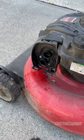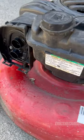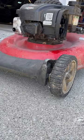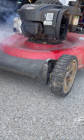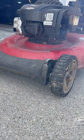Here I have my lawnmower. It's fall and a lawnmower is not going to be used for a while, and I've removed the air filter and the air filter housing. What I'm going to do is start this up and spray a little bit of the fogging oil down into the carburetor while the engine is running, and that will coat the inside of the engine and the intake and all the valves and all the parts inside of it, so that it can be stored without having to worry about corrosion.